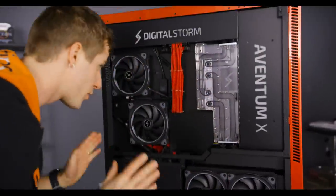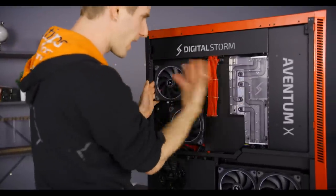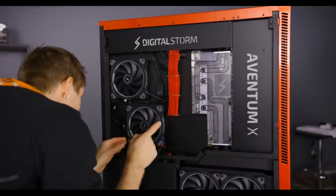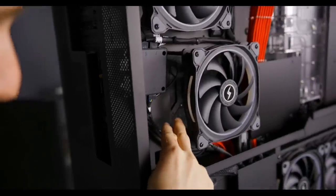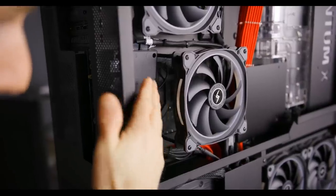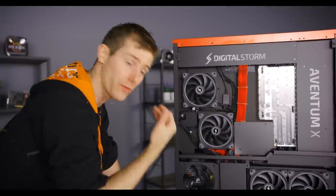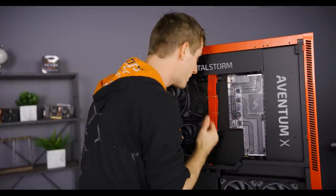So that's normal. What's not normal is that we've got this cooling fan that is almost right up against the glass panel. So it's kind of just recirculating air, cooling, I don't know, this Corsair Link controller module. And then we've got this one that is actually dedicated. Can you see this, Brandon? Come get an angle on this. That's actually dedicated to the back of the CPU, where it mounts to the motherboard. Because some motherboards actually do have heat sinks or VRM components back there. And normally, they wouldn't get any cooling other than what they get through the copper material that the motherboard is made of, conducting heat away from them to somewhere where there is a fan or a heat sink. So they've got a fan that just blows down on that. That's all it does. That's all this 140 millimeter cooling fan exists to do.